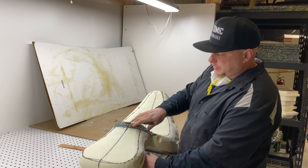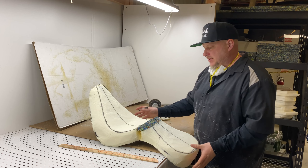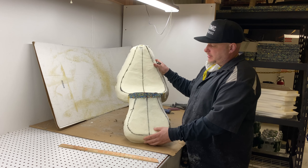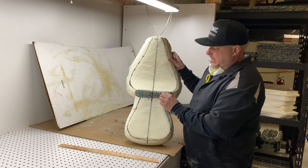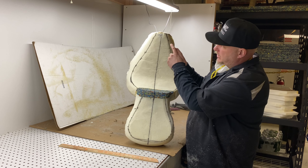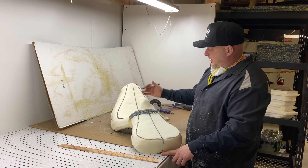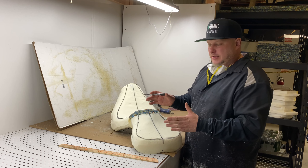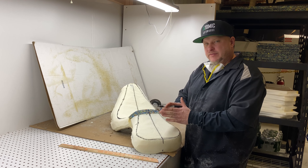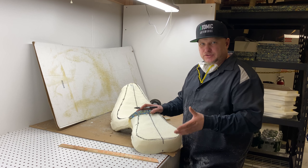Normally what we like to do is bring these seats up, scoop them, and give you a little bit of a kick. But we really can't go down on this one, and I don't want it to go up higher in the back. So I started to index it — because sometimes when you're taking a two-piece seat and making it into a one-piece, you get everything lined up and as you're sculpting, it looks wider on one side — like an optical illusion. If you index it, you can get your measuring points: mark one inch out on each side and measure from the tip to those points, and that tells you that you're straight. I put a rough line on the side so I can carve it flat and then sculpt the sides up to that body line — almost like making a body line when doing body work on a car. You bodywork everything to a crisp edge so that it gives you a straight edge, easier to see and feel. Similarly with upholstery, you mark your lines, sculpt up to this point on each side, and it gives you a nice crisp edge that helps make sure the seat is symmetrical and looks right.